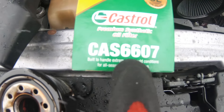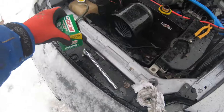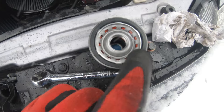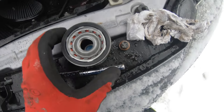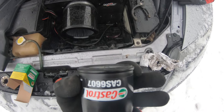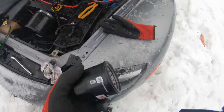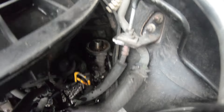Anything with a 6607 will do. This is hard to do with one hand in a snowstorm. We're going to take out the old filter and get a little oil on our finger and wet this rubber seal right here. Because when you twist this on and it starts to get tight, if this is dry it can actually tear or pull out from the filter, and then you've got leaks. So we're going to wet this and thread it on.